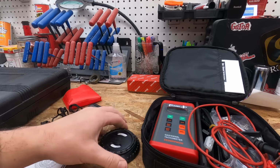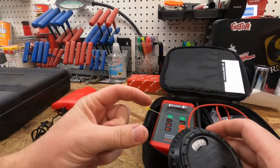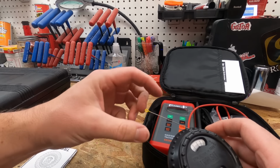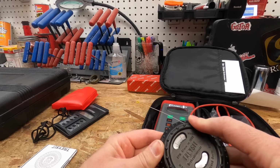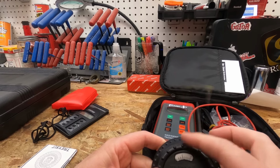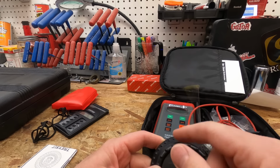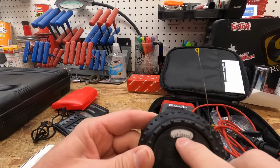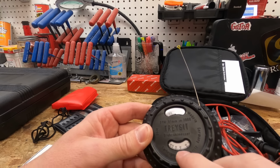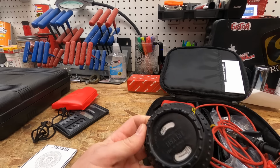This is the Briggs & Stratton one. I don't have the part number for you, but you set this on top of the engine, and you pull this out until it's vibrating, and when the yellow reaches its farthest point, that's where you read it. You can see this little yellow tab at its widest point, smooth vibration, and then you come down here and read it, maybe 31, 52. So these are pretty accurate as well.